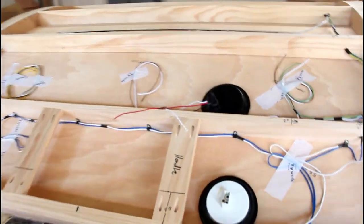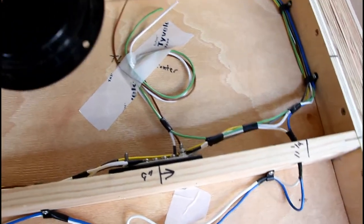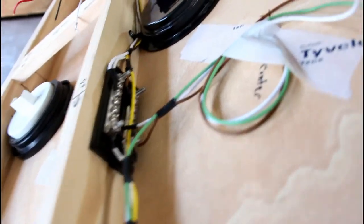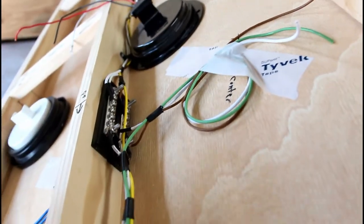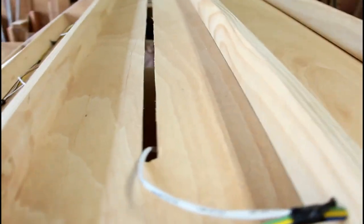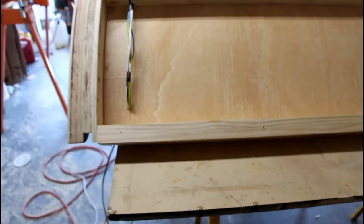I've completed the wiring for my hatch. I haven't done the connections for my taillights and reverse lights yet because when I put the external piece on, I still need to cut the hole out — that'll give me a big enough opening to get my hand in for maintenance. I've used common grounds and common power for all these lights, so if I ever need to get to the terminal block, I can just take out the light and reach in. I also have my LED light for the interior cut out for the RGB, and all that runs to the front at the top of the hatch.